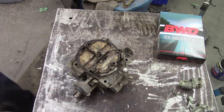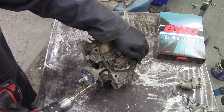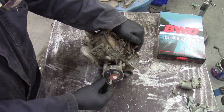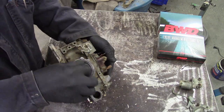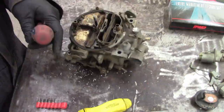This one has an electric choke. I drilled out the rivets — it was to be a number 23 drill. You can pop out the electric choke, it's just a bi-metallic coil. You don't necessarily have to disconnect everything on the choke, but I do.